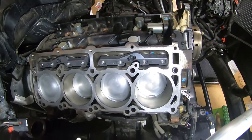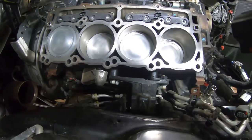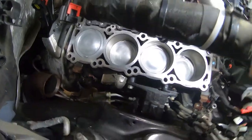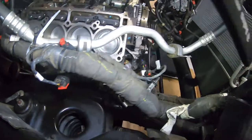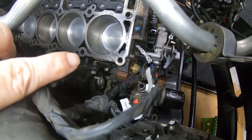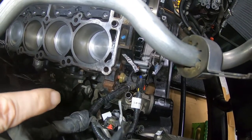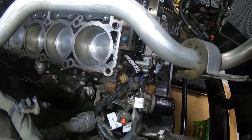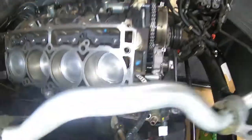Welcome back. We've lightly gone over the cylinder head and the bottom of the cylinders. You can see the rust line versus where the gasket surface is, and although the surface isn't a perfectly clean shiny silver, we got the majority of the old black sealant off where it needs to meet. I may concentrate a bit more around these right-hand-side cylinder ports before we put the gasket on, because there's still some black residue hanging around the edges.